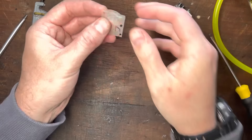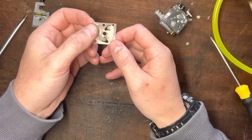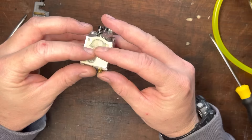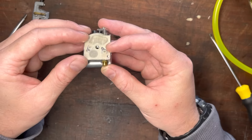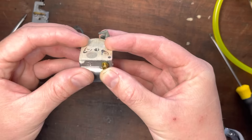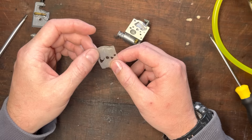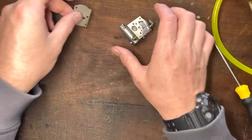Having a quick look at the fuel pump diaphragm — making sure that these little sealing valves, these little U-shaped valves, are not curling up or curling down away from the drillings in the carb. Make sure they're sealing nicely. They're just fine with the cover plate on. It can be quite deceptive because often on the fuel pump side these are a different sort of plastic to the metering diaphragm. So if in doubt, swap it out — they're only cheap.